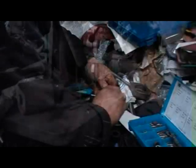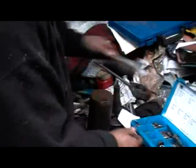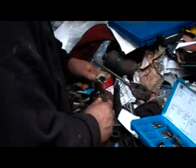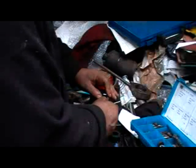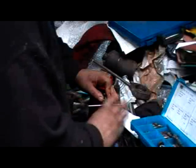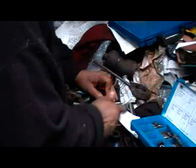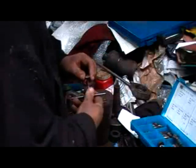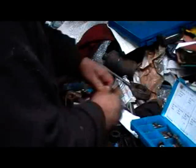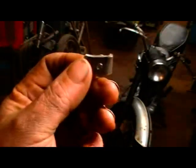At this point the rain is absolutely lashing down and the light has disappeared. With the hole drilled, you thread the hole — as I say, either 5mm or 2BA; I think 2BA is more like four and a half than five as a direct comparison. Here you can see me cheating — I'm holding it square in an adjustable spanner. Needs must. And there we have the little clamp.